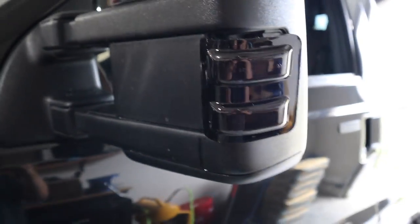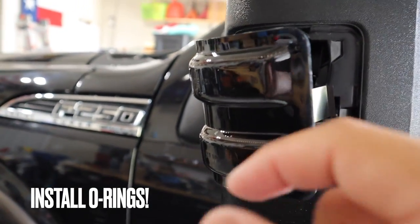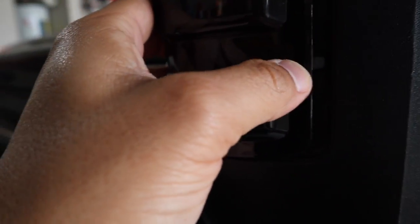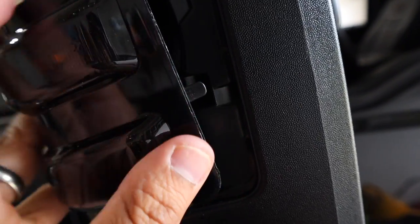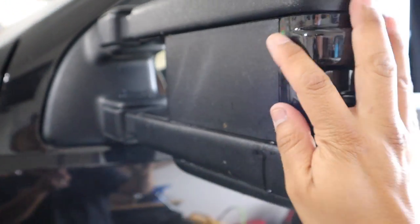Put the left turn signal on - boom, it's good to go. So we went ahead and put the bulbs back in the sockets, then twist them clockwise. The way it's going to have to go in: this tab goes in first, then slide it forward while making sure this little point right here goes into its little place. That's all it is - it snaps in. There you go, check it out - that is all it takes. It snaps in, awesome - looks smoked out.